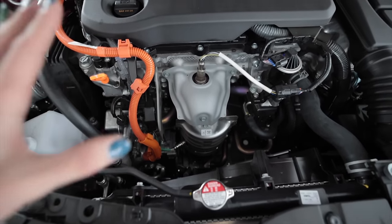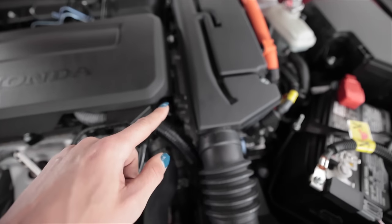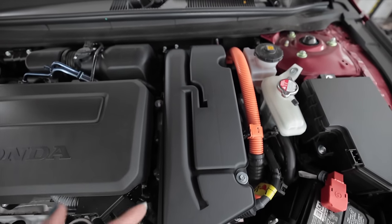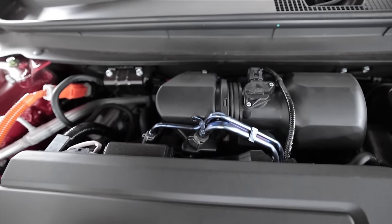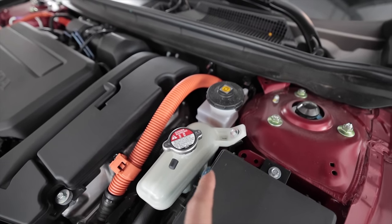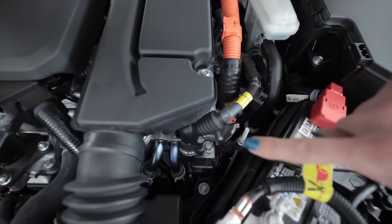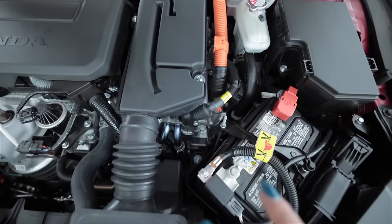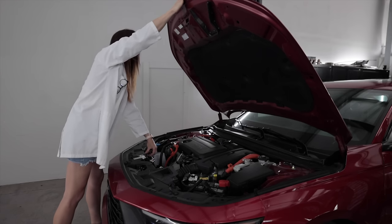Tons of room to access stuff to work on the engine. The air intake ducting goes up across the PCU right here on top of the electric motor, so it looks like it actually provides possible cooling for that system as well. Then it goes back into the plastic intake manifold in the back half of the engine. There's another coolant expansion chamber right next to the brake fluid reservoir — I wonder if anyone's ever going to screw those two up. Underneath the air ducting, there are actually two hard pipes for liquid coolant to run through this two-motor transmission system on the driver's side.